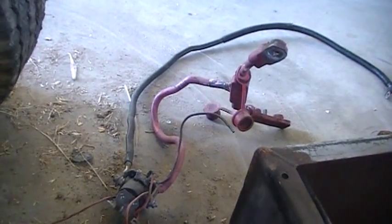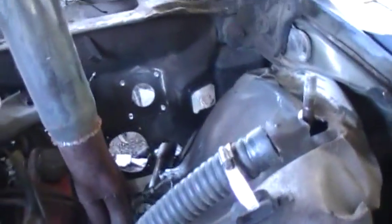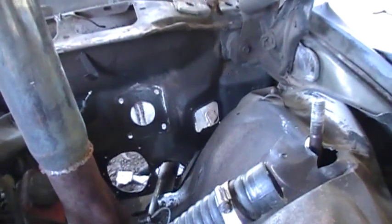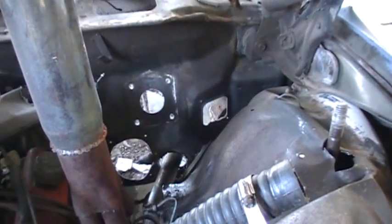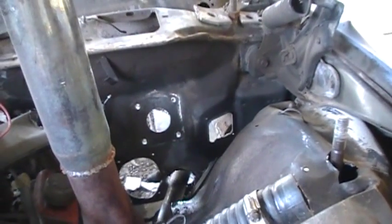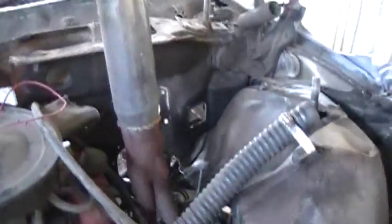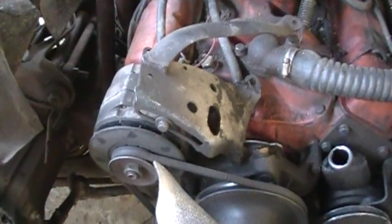That cuts down on the chances of fire. Even if you don't have a fire and your battery cable gets shorted a little bit, it'll run your batteries down, so this makes batteries last longer. Another tip: when you find a brake booster and a master cylinder that works — and even calipers, because aftermarket stuff has always gone bad on me — keep it. I basically have a complete brake system and don't even bother with the next car. I just put the whole brake system from the last car into the new car. Flex hose — best invention ever for derby cars.